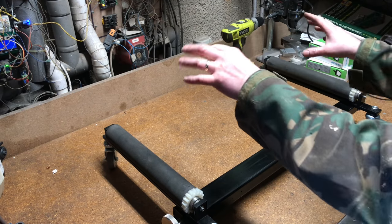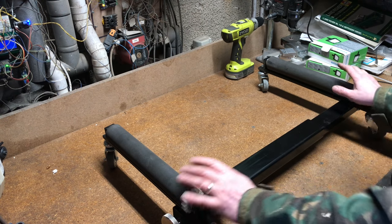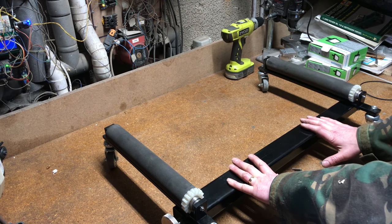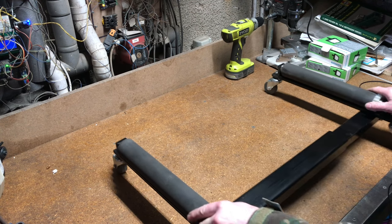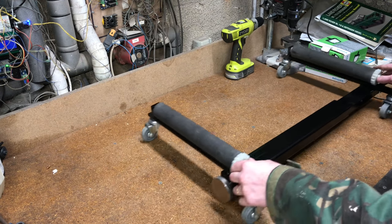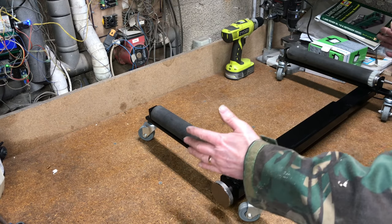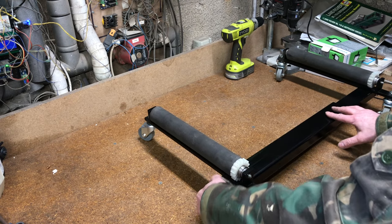We'll go out and you can see exactly what I'm talking about. Basically what I've done here is made a wheel carrier. It's not made to lift the whole vehicle — it's purely made to support the wheel as I take the nuts off after the vehicle's been jacked up. The idea is you slide this under where the wheel is and there's an adjustment here which, depending on which way you turn it, will pull the sides in or open them out. It's on a helical thread.